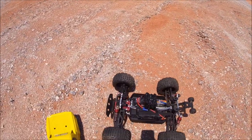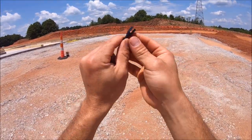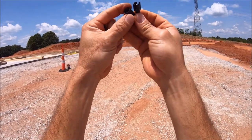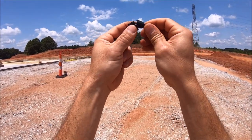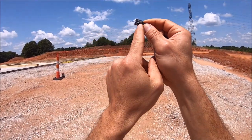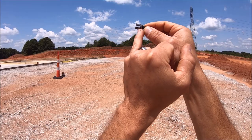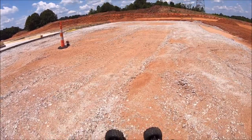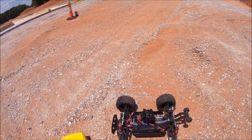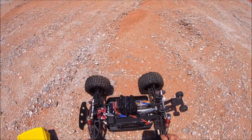For Mitch, this is still in testing — it's going to take us several months to get an actual wear test on these. This is a 4140 tool steel drive cup. This is a stock one right here, and as you can see over time they start to wear in. Some of them even break — they just get big gouges worn in, which puts a lot of slop in your drivetrain. Hopefully these M2C ones will wear nice and not get gouged out or break. It's a much tougher steel.